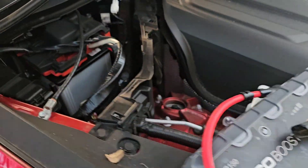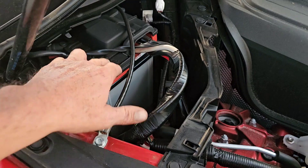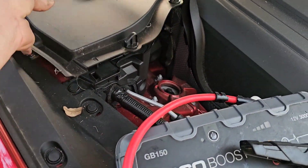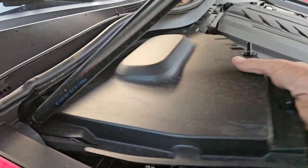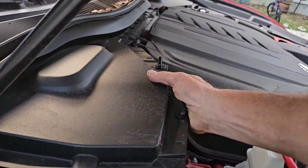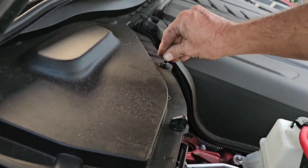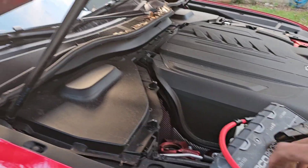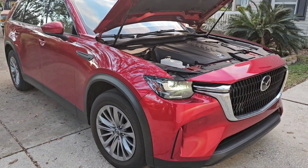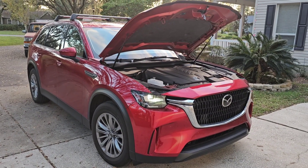Turn your box off or the other vehicle off and disconnect your cables — there you go, that's it. Put your little connection cover back down, slide this back in — it has a couple of slide-in grooves in the back, it just slides in like that, goes down, and then these things lock back in. Drive it to the parts store and get a new battery, or take it to the dealership if it's under warranty and have them replace it.